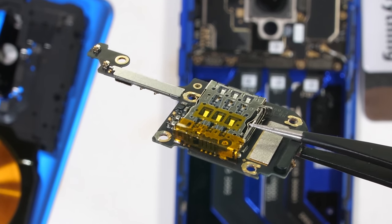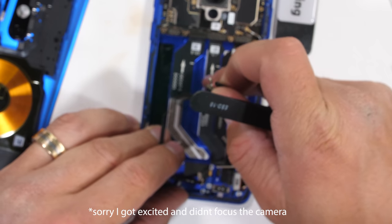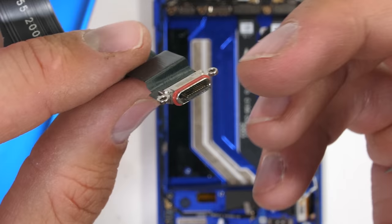Down here at the bottom we have the little circuit board. Unplugging a few wire cables and ribbon cables, and removing the two screws holding down the charging port — even though this phone has an ingress protection rating, there are still white water damage indicators inside the phone. No phone is waterproof. This little board just includes the dual SIM card reader. The charging port board can peel up and out of the phone — it's all on its own down here and easily replaceable. It also has its own little red rubber ring around the tip.